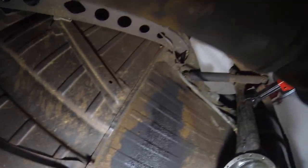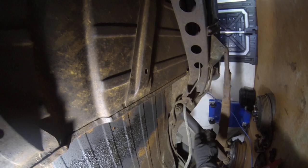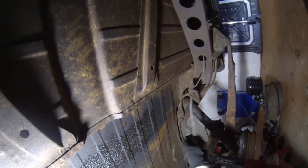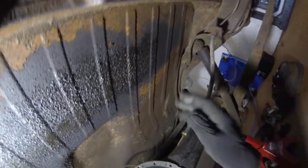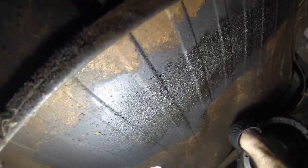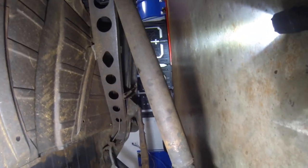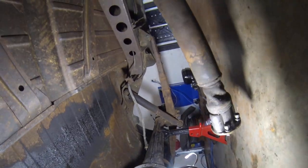There's a single brake line from the front master cylinder — a flexible hose that wiggles up and down as the car goes over bumps — leading to a distribution block, then one line to the left wheel and one to the right. I'm going to make two new brake lines here; they're old and rusty. I also have a new hose. I'm going to rebuild this universal joint here — I've ordered a new kit and I hope it comes with a leather boot. Old-school style.